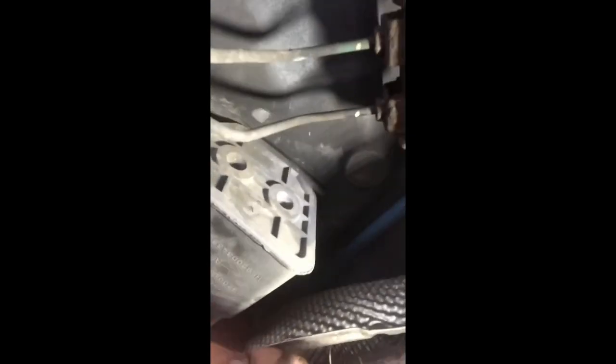Moving further back to have a look at the fuel tank — make sure there's no leaks, and the fuel filter too. That will be our fuel pump — it's a plastic tank on this one so there shouldn't be any leaks, but you never know. It's all looking alright under here. There are a couple of brake lines at the back — you can see where the unions are for them, it's all okay. A little bit of corrosion on the rubber bits but nothing too untoward — you'd expect to see that sort of stuff. No leaks, everything's okay.